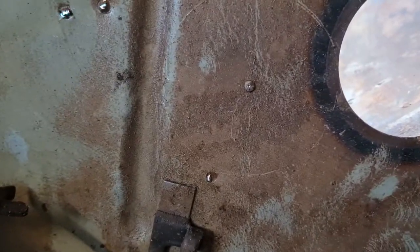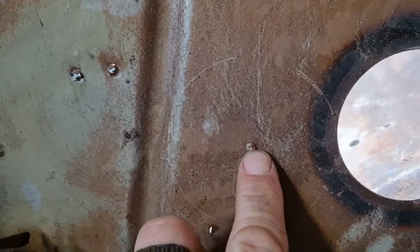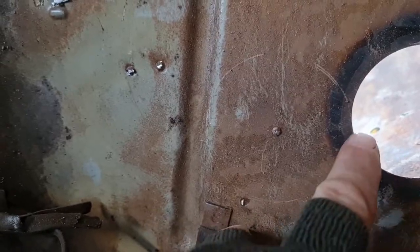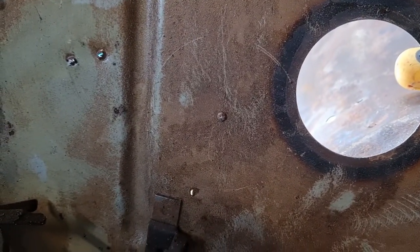I pushed a dimple through from the engine bay back into the footwell to get a little spot point. Then I was able to etch the circle. I was too lazy to drive up and buy a core set, so I'm just going to see if I can snip it out with a snipping tool. I already have access to this hole here to start with, so I'm just going to give it a shot.